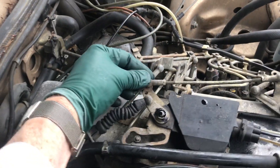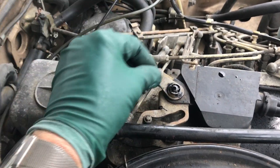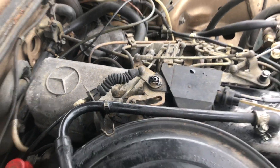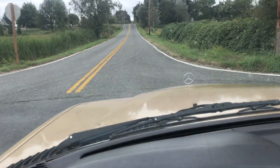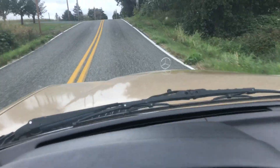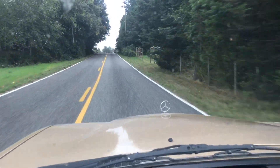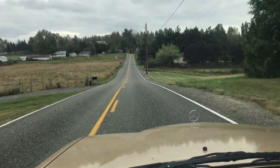This whole linkage is going to need lubrication. Look what a little engine oil did to this lever - it springs right back now, not binding up. I've got a little bit of play in there so I'll adjust it a little bit more. All right, let's floor it. Wow, what a difference - all the way up to 50 miles an hour and then it shifts into fourth. Smooth - no more jerking! Can you believe that? Ten minutes and zero dollars - those are the type of repairs we all like.